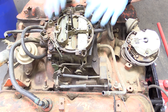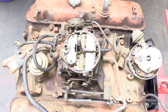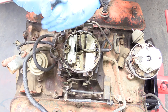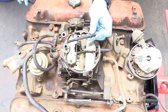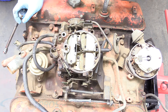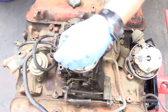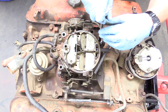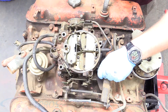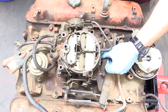I think we're ready to take the carburetor off. The fuel line is mounted to the intake manifold, and I'm not going to take it off the carburetor — I'm just going to remove it with the carburetor, so we need to remove that nut, which is a half inch, then remove the carburetor bolts, also half inch. This carburetor is a little funny where the bolts go all the way through the body of the carburetor into the intake manifold. In keeping with the theme of this junkyard engine, the top ones aren't even tight — but the bottom ones are. There should be four bolts holding it to the intake manifold. The carburetor has part of the throttle linkage with it and it's spring loaded, so be careful.